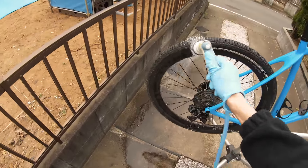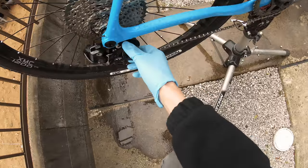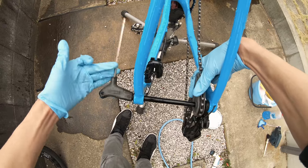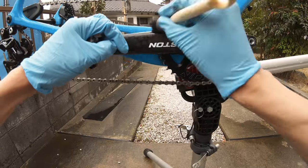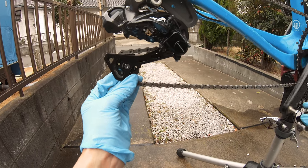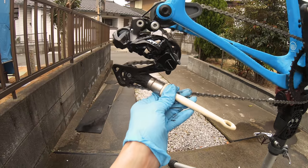Once the bike is on the stand, I start by rinsing the bike, the drivetrain, and the rear wheel with my garden hose on the weakest shower setting — you don't want high pressure around the bottom bracket and bearings. After rinsing, I remove the rear wheel and use my Pedro's chain keeper. Then I spray degreaser on the chainring and around the rear derailleur, and use my detailing brush to brush off the worst gunk. I use rubber gloves so I can pinch the pulley wheels as I turn the chain to remove the nasty gunk around the pulleys — definitely give this area extra effort.